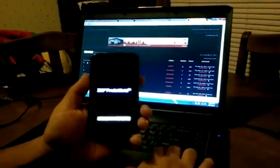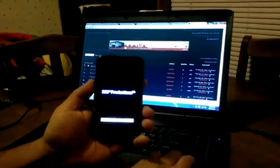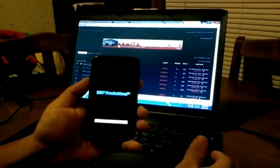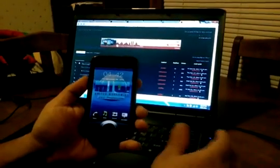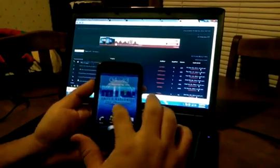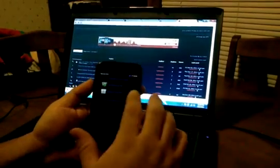Now we see this MIUI boot-up animation. A lot of people think that because it came on, they could just pull the battery or turn it off and go back to flashing. Or even flash it without letting it fully boot. See how it's non-responsive — it's still trying to boot up. You're going to have to choose a launcher. You can go with Go Launcher or the MIUI launcher. Wait until it boots up to a usable state.